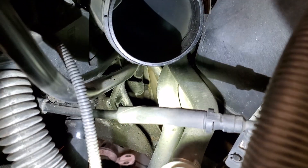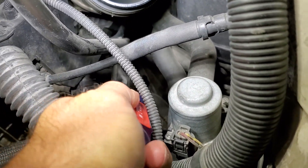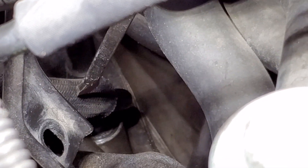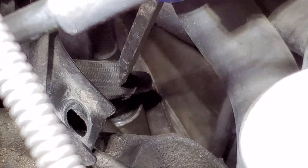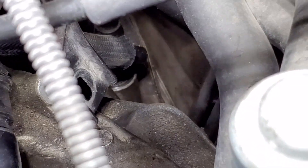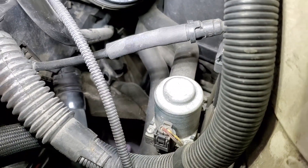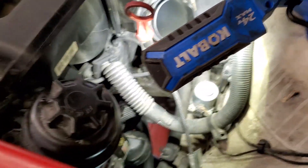The reason why I didn't take the dipstick tube all the way off is because this braided-looking rubber hose goes up to the bottom of your CCV/PCV valve, and it slides onto the metal part of the dipstick tube down there quite a bit. I tried to peel it off a little bit, it wasn't coming, and I didn't want to break it where it attaches to the CCV. So I just left it and slid it out of the pan as I got ready to drop the pan — that's all you really had to take off on this side of the engine.